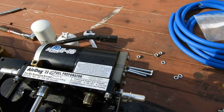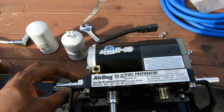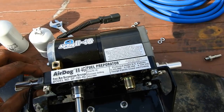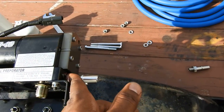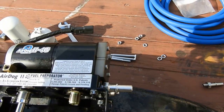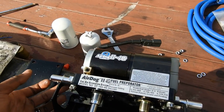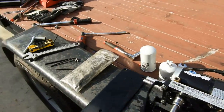You get that sharp rise of torque when you're turning it, just barely like an eighth of a turn after, and you'll be good. It's better that you don't tighten it enough, because the worst thing that can happen is when you go to prime the pump, you'll notice the fuel coming out. So all you can do is just snug it up until it stops and you're good. Compared to monkey wrenching it, and next thing you know, you snap it off in the block. So just keep that in mind.